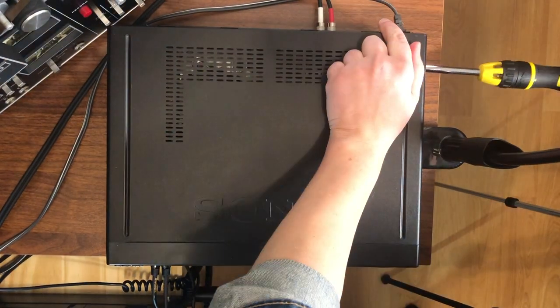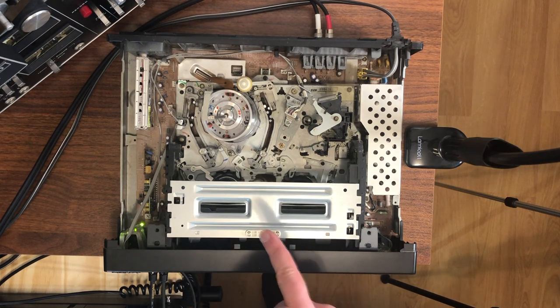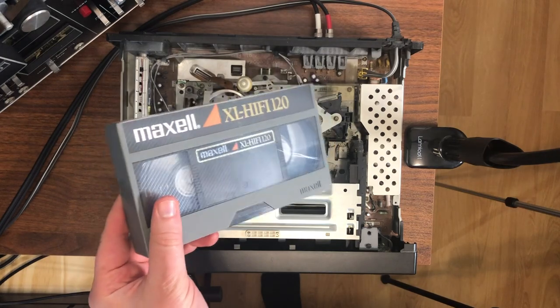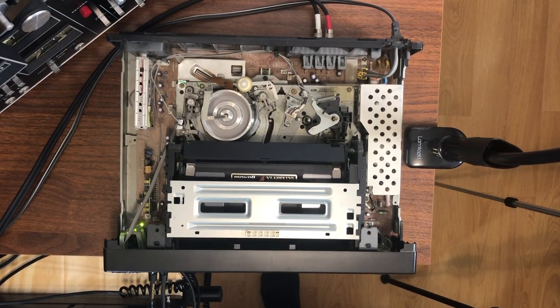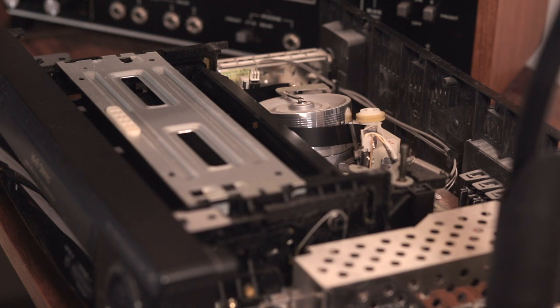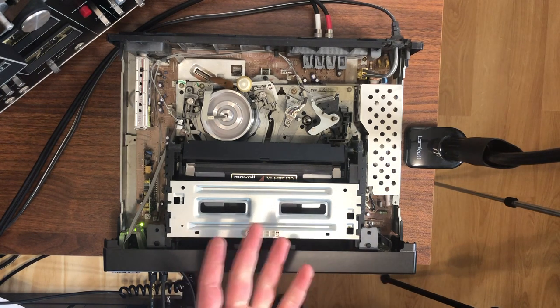So instead of trying to explain it, how about I just take the lid off of this VCR for theatrics and optical sensations? Fascinating what's going on in here. And you can see on my camera angle — that's the tape head, and we're going to watch it spin. Let's throw a tape into this. I happen to have my favorite brand, Maxell. Look at that — isn't that cool? Check out the tape path. In essence, it's this spinning head that gives VCRs hi-fi audio, because tape speed greatly affects the quality of sound. So those are the guts of the VCR.